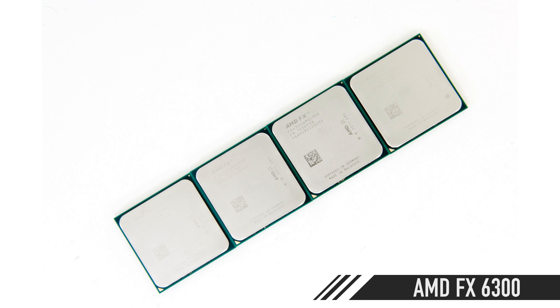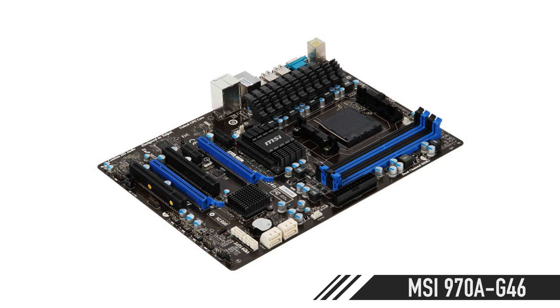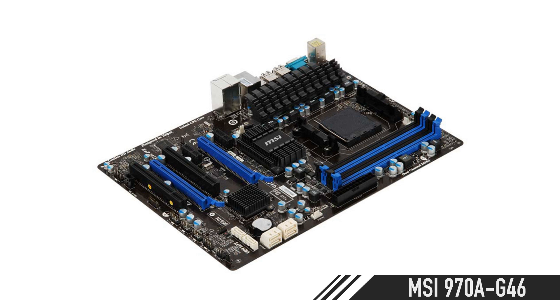For the AMD option, grab the FX-6300 — it's 3.5 GHz, a brand new six-core, and they fixed a lot of problems from last generation. I like this one better than the 1100T, which I've been recommending for mid-grade builds. For the motherboard, the MSI 970A G46 supports 2133 MHz memory and has six 6-gigabit-per-second SATA ports. There's no USB 3 header, so with the case I'm recommending you won't have front panel USB 3, but at 58–59 pounds that's fine.